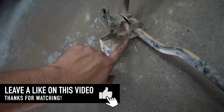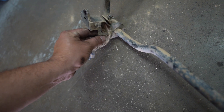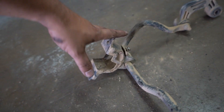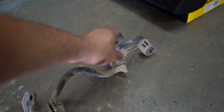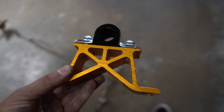This is the OEM bar for the rear — it's ridiculously small. On top of that, these brackets that it mounts to the chassis with are fairly thin; these ones are actually already rusted and really thin and crappy. Now the cool thing is Whiteline makes an entire replacement for this whole setup, so this thin bracket goes, and this plastic sway bar link also goes. Let me show you what we got.